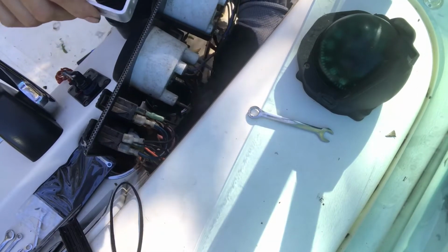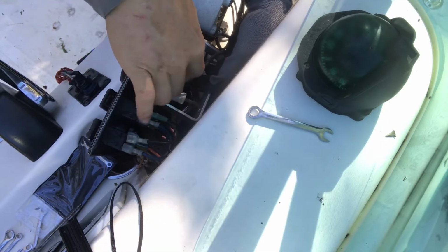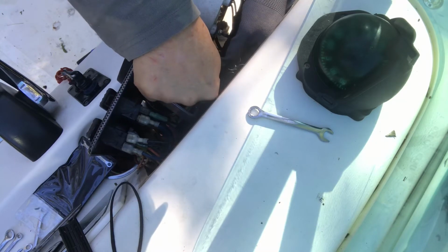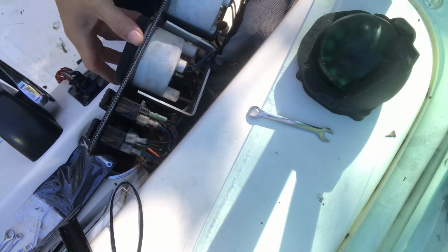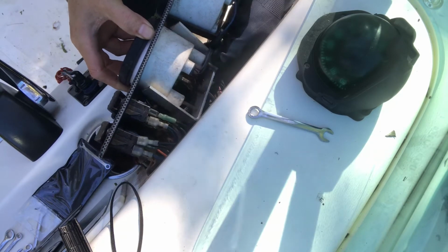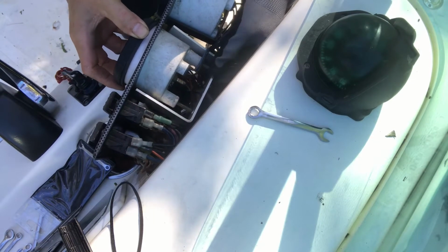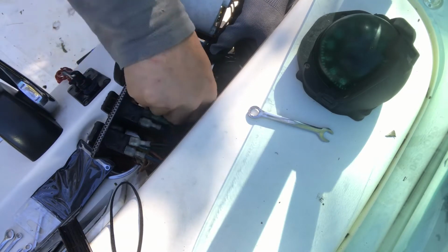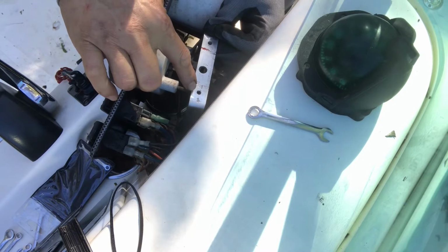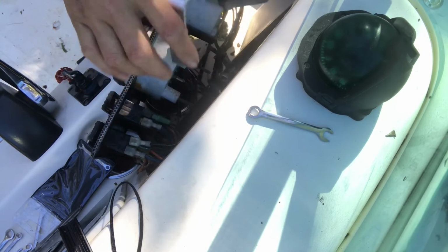Alright guys, so here it is. See the hole? We should have it back in there. Before you put this back onto the meter, make sure the two bolts go through there precisely. See if the hole needs to be adjusted at all. See, now I need to open up the hole because it's not precisely the correct size, and we cannot bend this. The distance between here and here is a little too small. It's probably 1/16 smaller, so now I need to make the hole a little bit bigger so it can fit this screw in there.